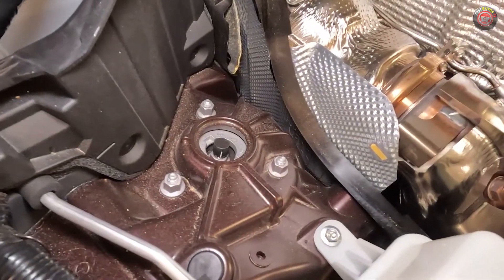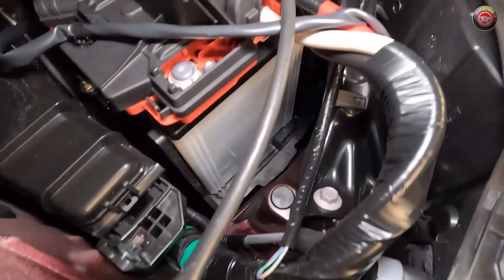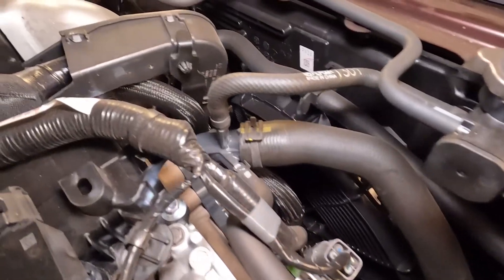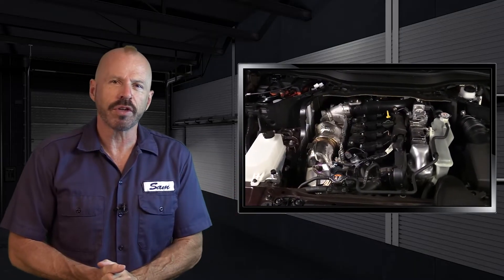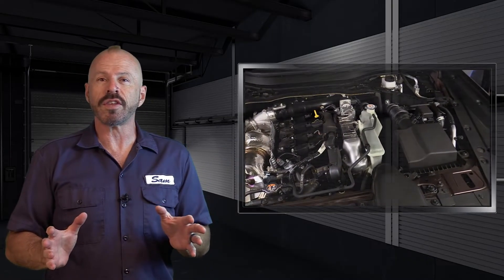Looking around the engine compartment, a few items of note. The Mazda CX-90, being a little bit more of an upscale product, uses cast aluminum shock towers for extra strength and light weighting, braced to the firewall bulkhead with substantial steel outriggers. Looking ahead to the front, you can see the electric cooling fan — always keep your hands clear, even when the engine is turned off. Well, there you have it, my friends — under the hood and all of the technical nuts and bolts around the all-new 3.3-liter turbocharged inline-six of the CX-90. We have a full test drive on this vehicle on our partner channel, Test Driven TV. You can also subscribe to TDTV Garage if you're into this kind of technical content. Either way, stay tuned.